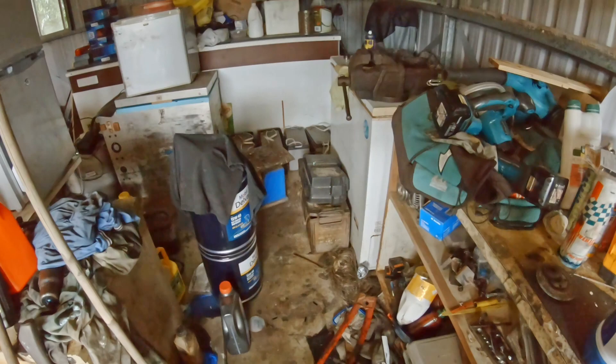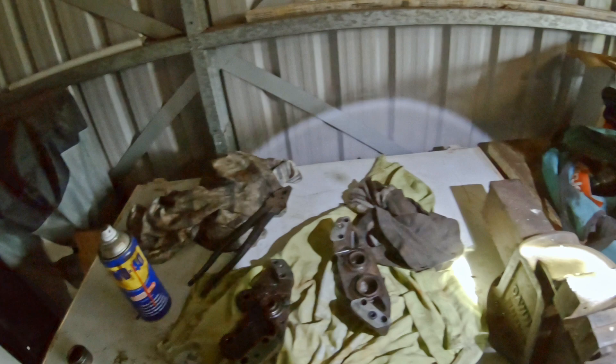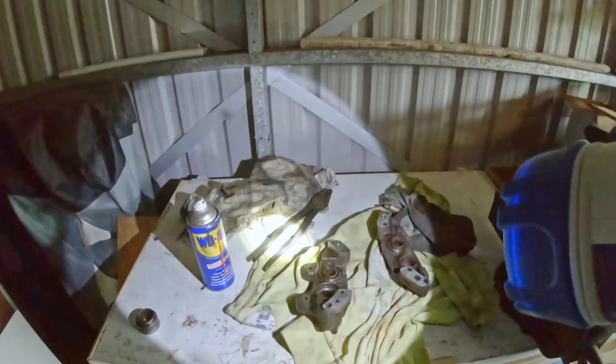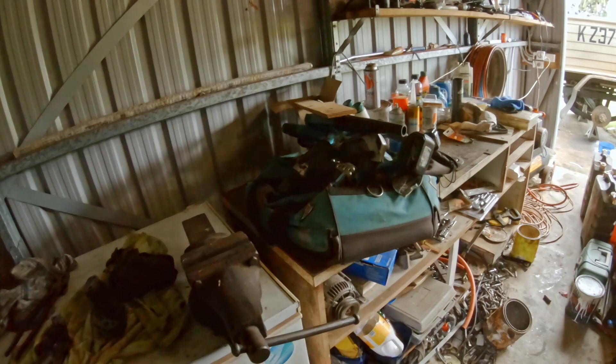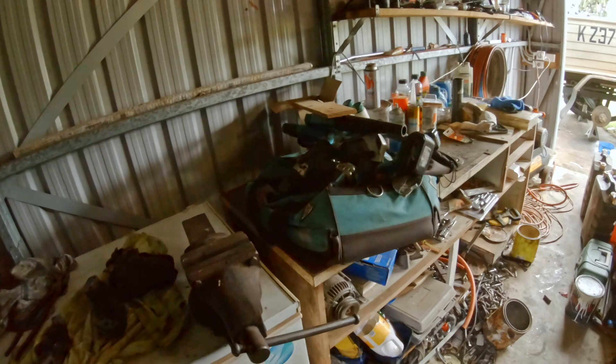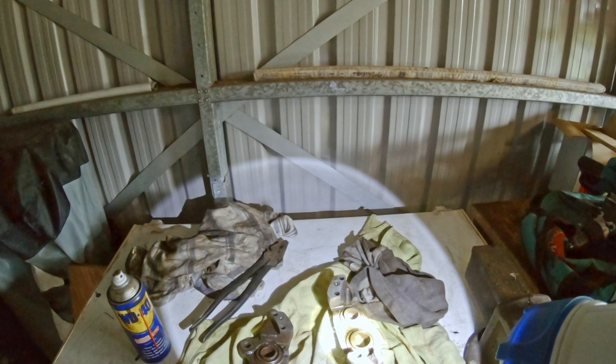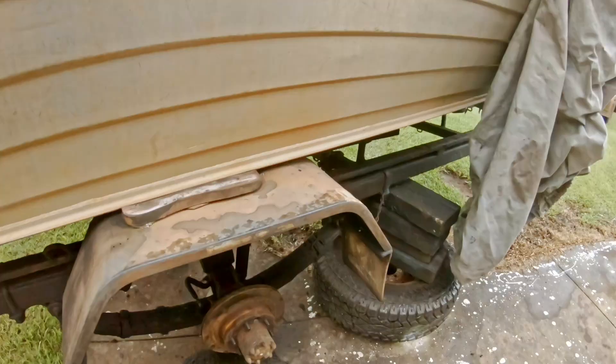Moved inside to my workbench - it's a 320-litre freezer that's still working, got my bait in it. I've put a vice on top of it. I'll put the caliper in the vice and use fencing pliers to grab the lip of the pistons, or use vice clamps. If they don't come out you get the butane torch on them - the heat burns off any rust buildup and they pop out easier. Do that outside of course - there's four jerry cans full of fuel in this shed.